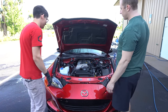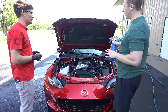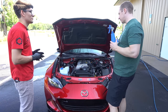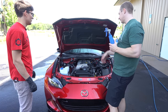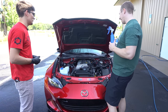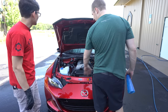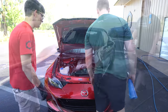If we were going to clean the engine, I mixed up Meguiar's D101 diluted 4:1 — that's an all-purpose cleaner — and then would spray hyperdressing at about 3.5:1 dilution. But this engine doesn't need it. In six to eight months Bryce can pressure wash it and hit it with hyperdressing: spray it on, close it up, walk away. Jams look good too — sealed all the way around. We'll be able to wipe that off when drying.